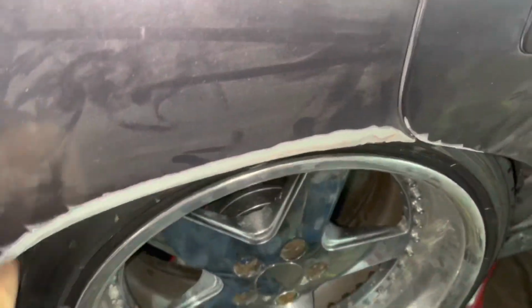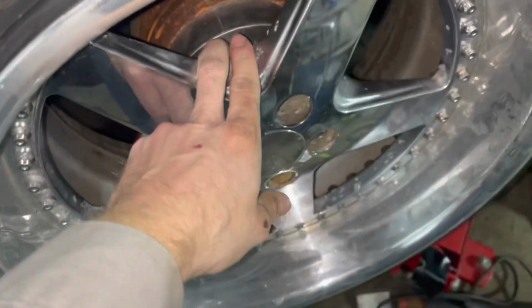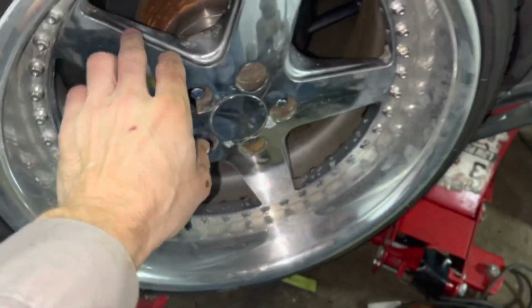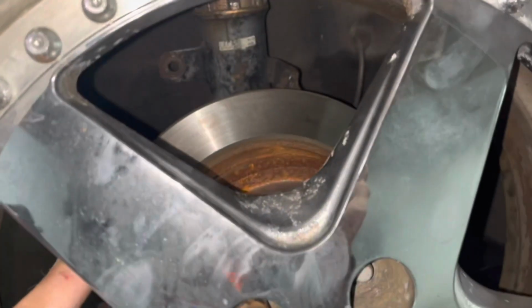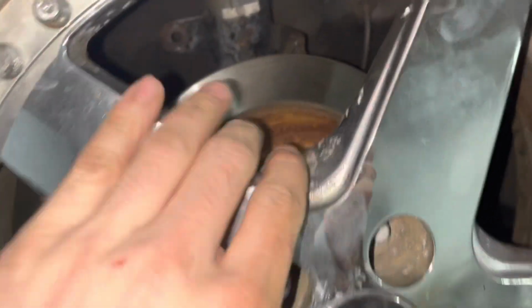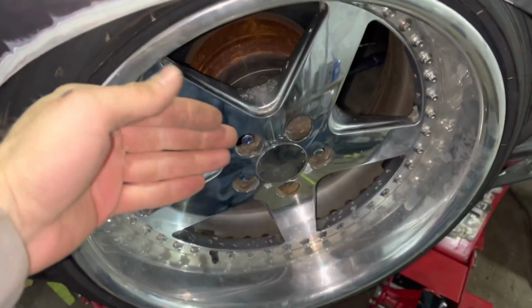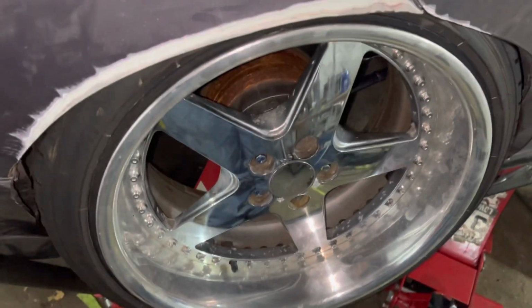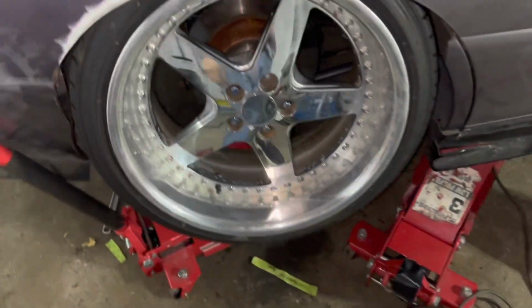All right, so without a smaller tire and bringing the wheel in, I had to put the other spacer on because it was hitting the coilover. So one of the things I got to do is take camber out of the top of the coilover, so then it's not going to hit it, and I can use one spacer, because I do have another 1.5 inches where I can push these arms out. So taking the spacer off isn't going to hurt me much at all, since I have so much adjustability.